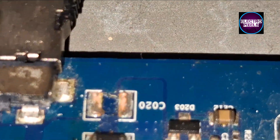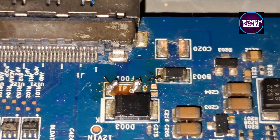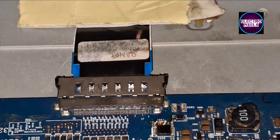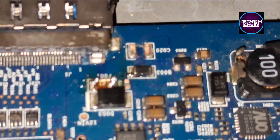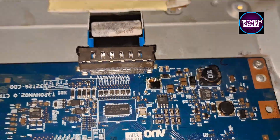We already repaired the TV. While checking, I found that the panel fuse is open, then I joined the panel fuse using a copper jumper wire. After that I checked for shorting, and I found that from the panel VCC section, this PF capacitor is short to the ground.